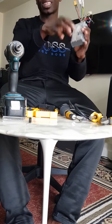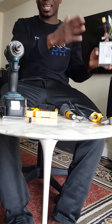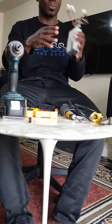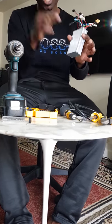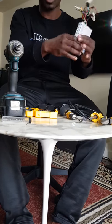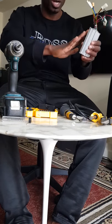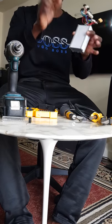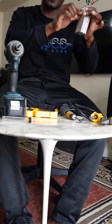We're talking about so many things on the board. Any of those can go wrong, or maybe faulty manufacturing, or maybe some of them are even a dry joint. Why a dry joint? Usually the components on the circuit board, the green board that you see in those devices, the things that are soldered on it, some of them are not actually soldered. They're not having full contact.